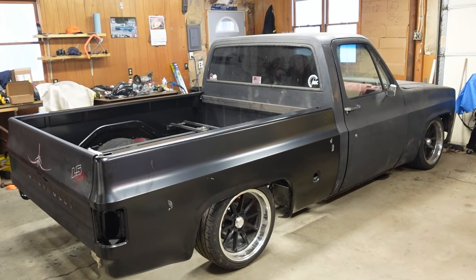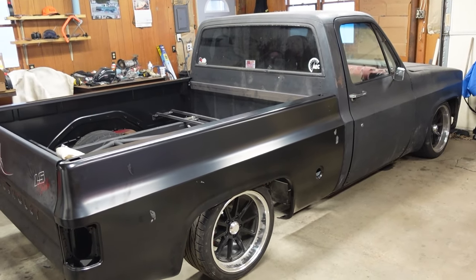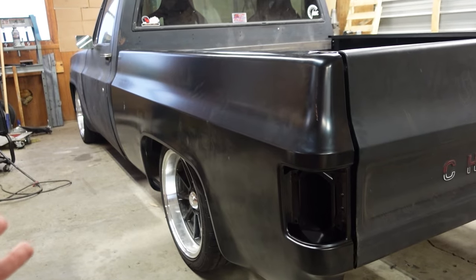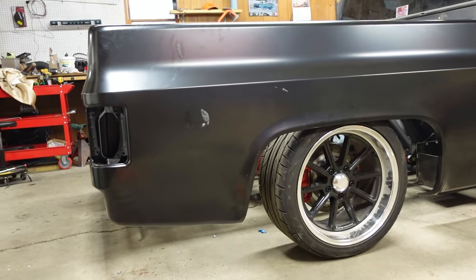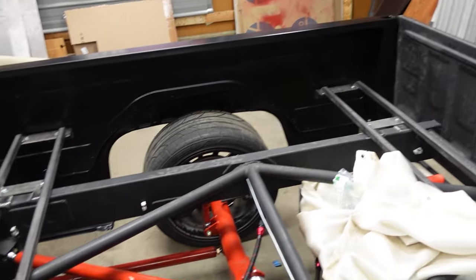This thing has some epic attitude — the front clip is fully mounted and the box is fully mounted, so this is what this truck is going to look like. The footage of mounting the front clip was mysteriously deleted off the camera — definitely not by me on accident — but it's nothing fancy, just an L-bracket going to a piece of angle iron to the factory mounting location. I'm not the happiest with how those brackets turned out, but there's a tubular core support in the future, so they'll work for now. The box is much more exciting — these are a set of Auto Metal Direct brand new box sides, and they are by far the nicest aftermarket panel I've seen for a square body. I drilled two holes for each mounting location to mount the box at the new bed height.